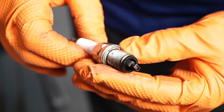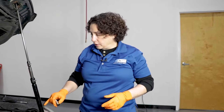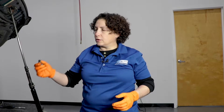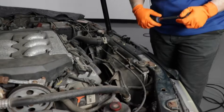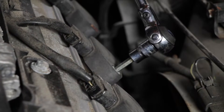I'm going to do something real simple. If you don't have compression scanner tools, I'm going to swap — take a coil from the front and a plug from the front, and swap them. Run it, clear the codes first, then run it and let's see if the skip switches over to a different cylinder. That'll tell us it's either the coil or the spark plug. If it's either one, I'm going to do both at the same time. So I took cylinder three apart — spark plug and coil — and I'm going to swap it with cylinder five up in the front, right in the middle. I'll transfer the spark plug and ignition coil over to cylinder three.